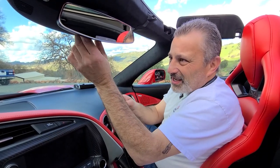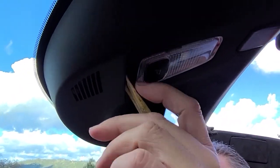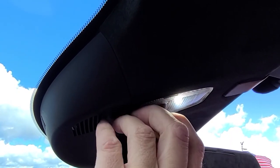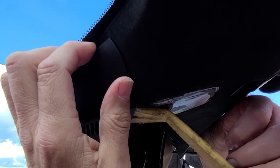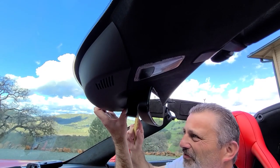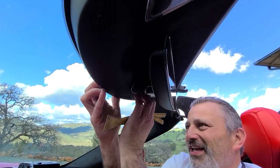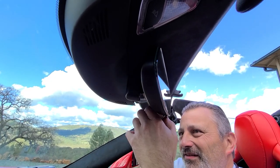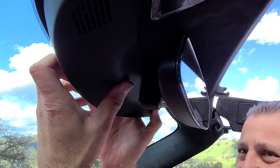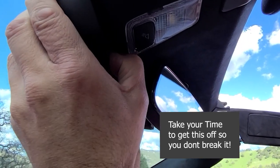We've got to gain access to the power behind and above this mirror. We're going to get right up in here like so, and then you can just pry this down just like that. I'm going to pull this open on my side doing the same thing. We're going to get it down just like that. Then you'll be able to pull this down — just got to wiggle it down. Just be careful, but you will be able to get it free. Sounds like you're tearing the car apart, but if you're careful, you'll be fine.